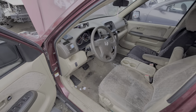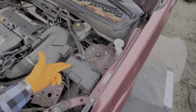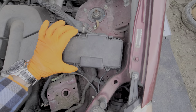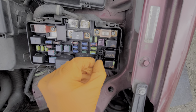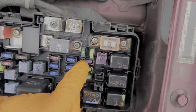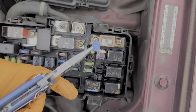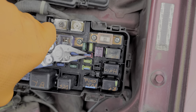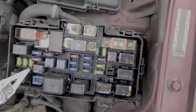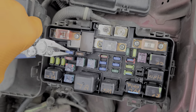To begin we're going to head under the hood. This is where we can find a fuse that provides power to the brake lights. It's going to be behind this cover here, which we remove by squeezing these tabs together and lifting upward. There is a fuse puller that you may use right here. The fuse in question is a 15 amp fuse located right here. Power from that fuse is sent to the stoplight switch, and that stoplight switch sends this power on to the brake lights when you apply the brakes. Power from this fuse is also used for the horn. If you find that this fuse is blown, there is a spare 15 amp fuse located right here. You'll want to make sure that your spare fuse is not blown as well.